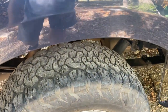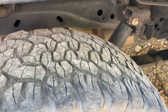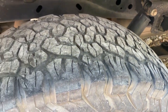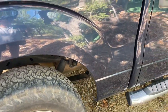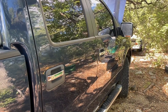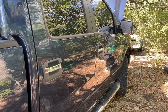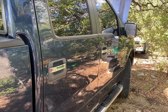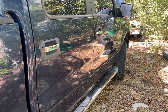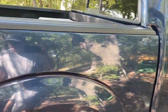The rear tire — the outside is cupped, the middle is not looking too bad, and the inside is cupped and worn. At least somebody's been rotating the tires — somebody has taken good care of it. It's had a fresh oil change. I'll pull the air cleaner off and see if we need to replace that filter, do a radiator flush since it's low anyway, and change the in-cabin air filter — it's probably full of that cherry block.